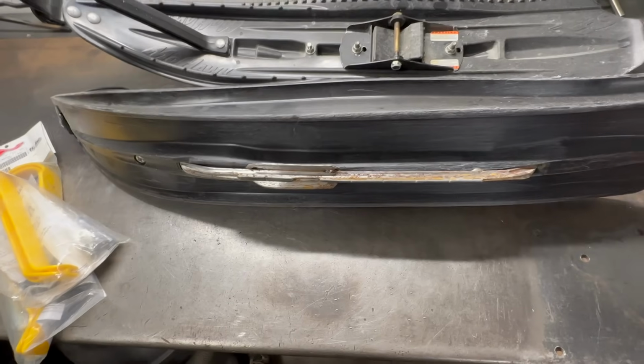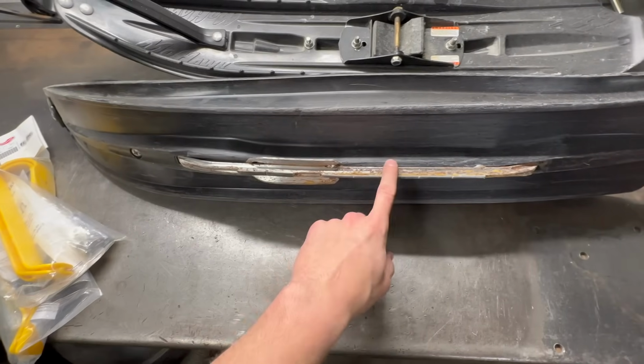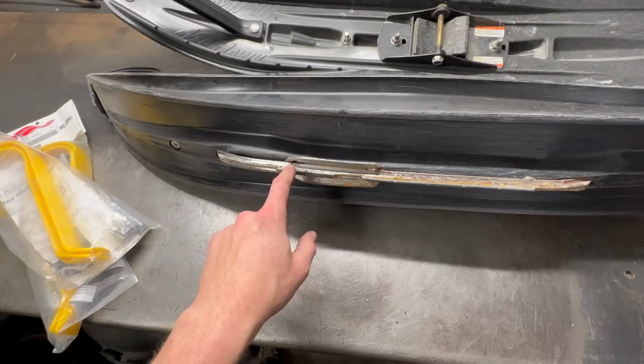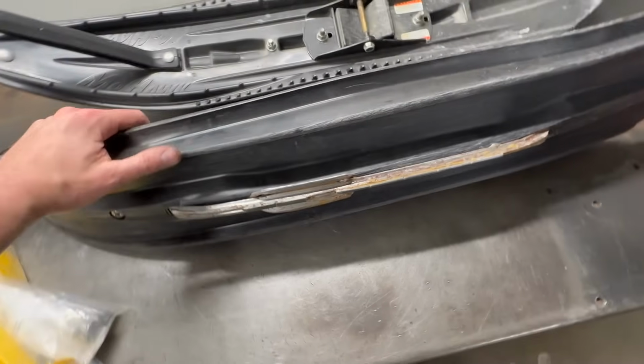That ends up pushing for us big time, you know, those of us that ride aggressively. So what we always used to do to run a big bar that was aggressive enough, but take the darting out, was take the plasma cutter and blow that stud out of the keel blade. And then you run this whole setup right here.